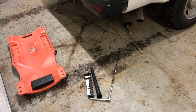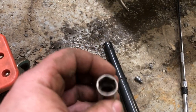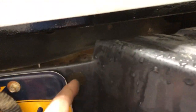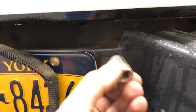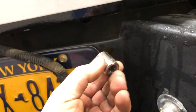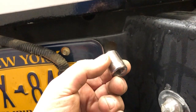And I looked on the internet. People said, all right, what you do is you get a 9/16 6-point socket, and you put it down the spare tire hole. Now, if you look in here, the tube's missing, and we'll talk about that in a minute. But you take this 9/16, put it down with a long extension, and hammer that bad boy onto the lock, and you'll be able to turn it off. Well, that was some straight up BS.